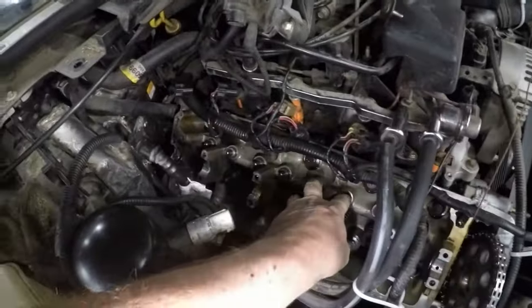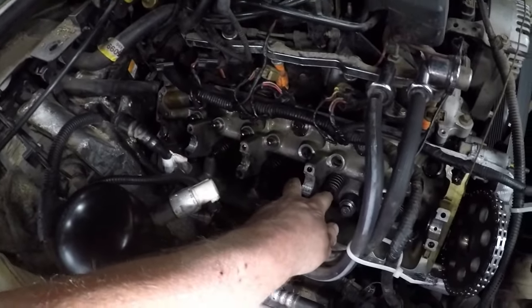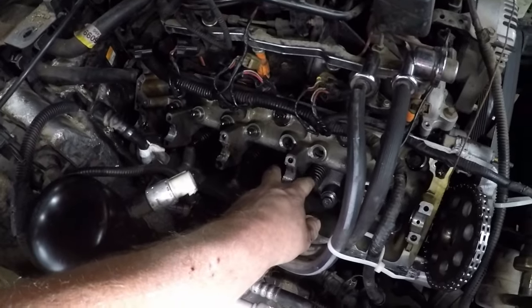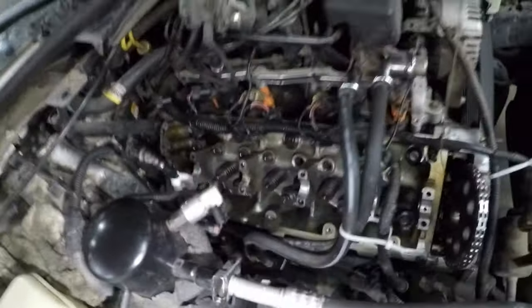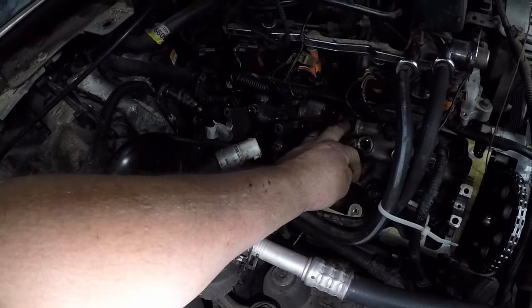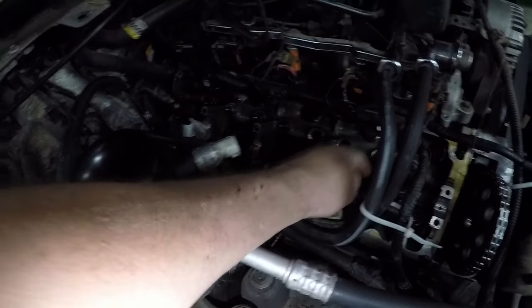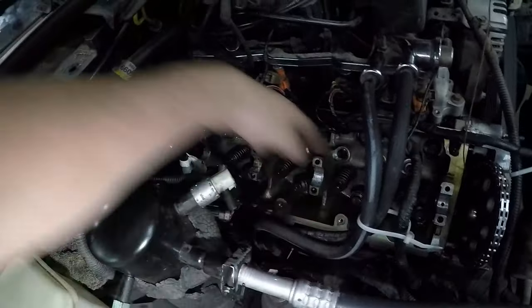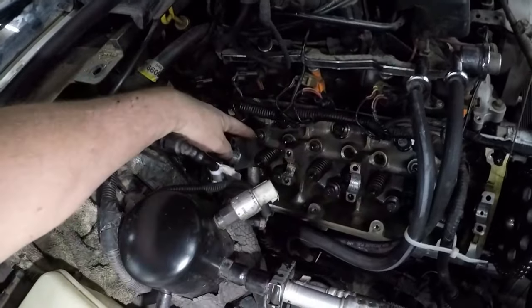Because what I thought at first was, it kept dropping cylinder 2 and cylinder 4. And I thought, this vehicle had been sitting for a year. And when I fired it up, I thought, okay, maybe the fuel was bad, and I had stuck valves. They were sticky, sticking open. Because the rockers were just loose in there. But as soon as the cam lobe went in there, obviously it did push the valves in. But when it came back, they were so loose that they would just keep falling off. The same two, these two here and the number 4. I'm not sure how these things fire, but cylinder 2 and cylinder 4 at the back just keep dropping the rockers off.